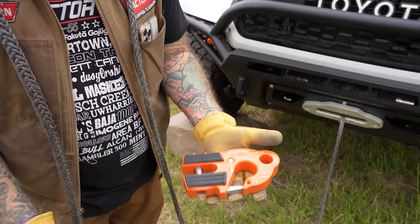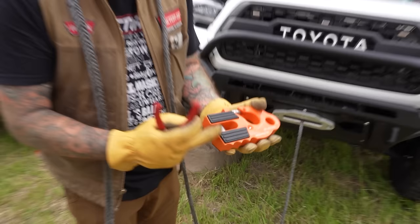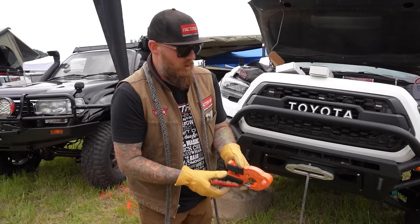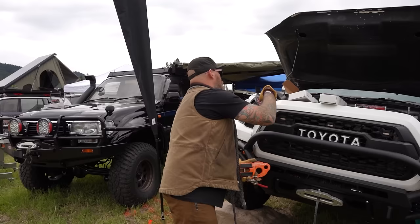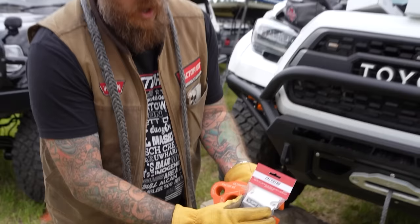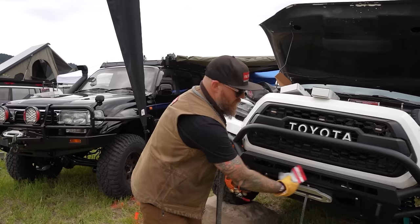Our UltraHook — like we were talking about before, where you had that hook bouncing up and damaging the fairlead surface — this hook has integrated EPDM rubber pads. There's going to be no metal-to-metal connection on the front of your fairlead anymore. This will lay flat, retaining your approach angle and allowing the rope to be completely protected behind the fairlead surface until you're ready to use it. We're also going to give you our rope guard, which uses aluminum driver rivets to stick on between here. The rope guard acts as a skid plate, fully protecting the eyelet and the end of the winch line.